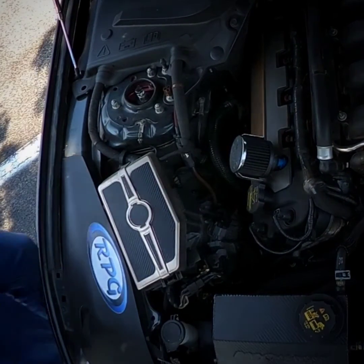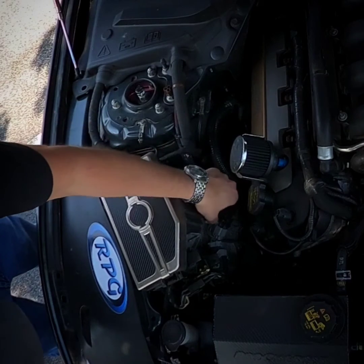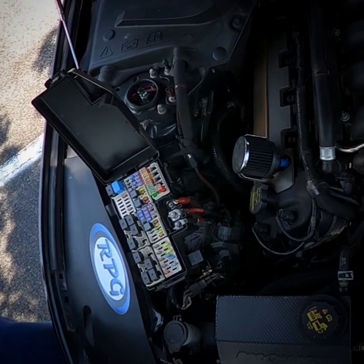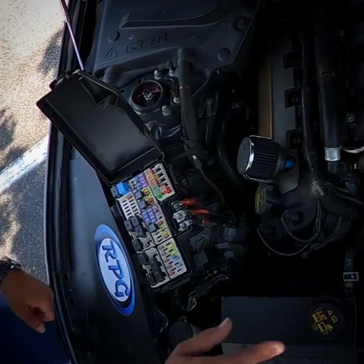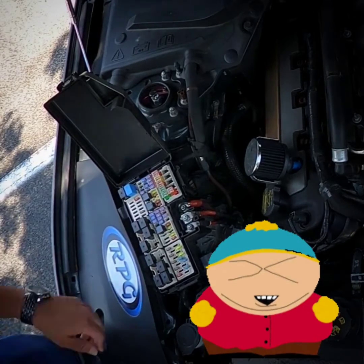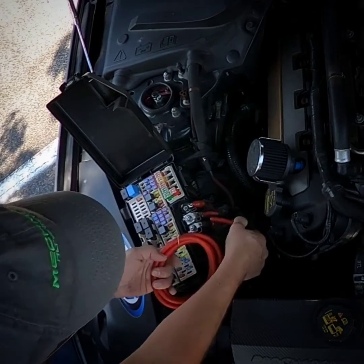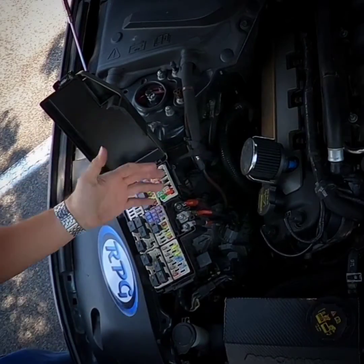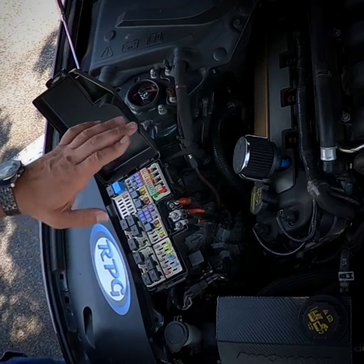What's being done is the power wire from the alternator — if done correctly per NHRA or spec class — runs to the back. This is my car right here, a pro-charged coyote engine. A lot of people are doing these coyote swaps. For my alternator, this is the size of the cable. This right here is four gauge wire — real deal four gauge, oxygen-free, very flexible. That's what OE manufacturers do: they put the bare minimum wire to save cost.